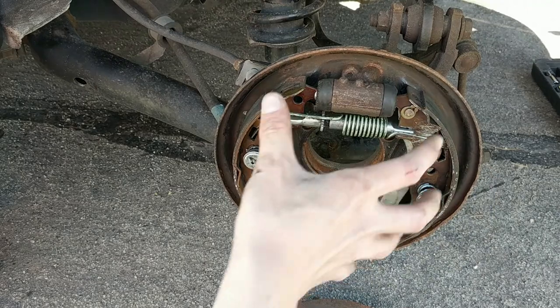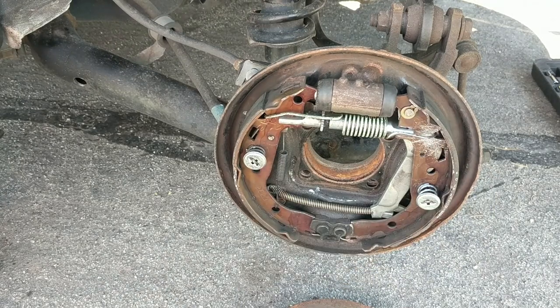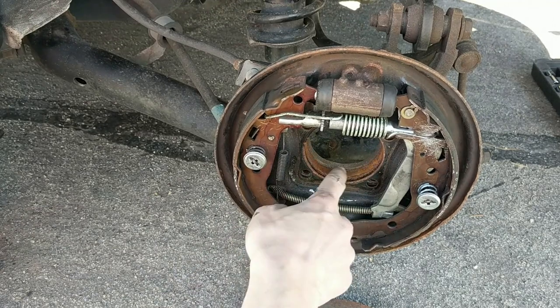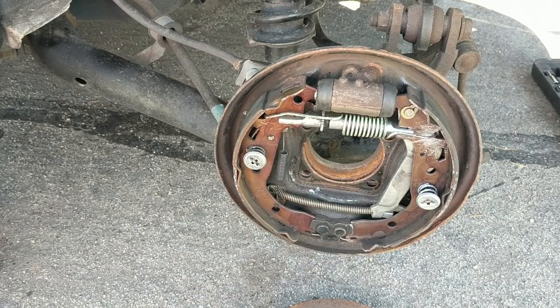Taking a closer look, you can see the ring, the four bolt holes, your dust shield, and your whole brake assembly. What you want to do now is take a copper wire brush, brush this out, and smear some anti-seize in there so that it's not going to lock up on you if you ever do this job again in the next decade.